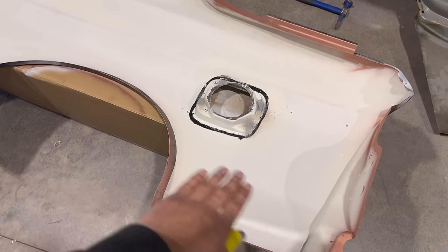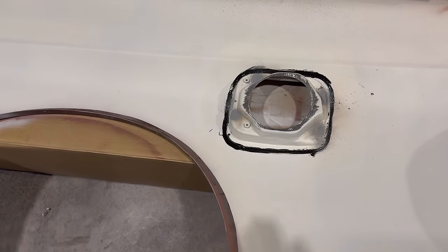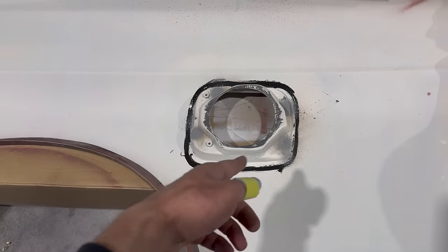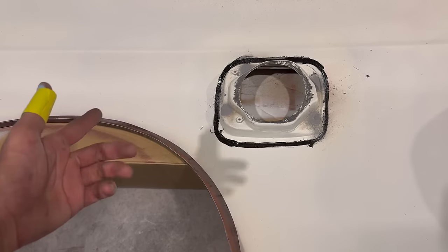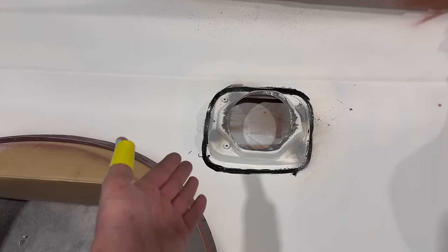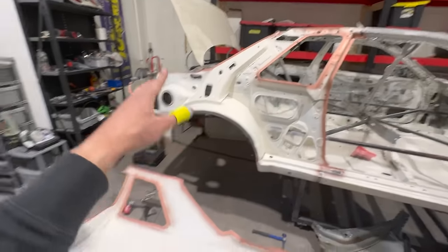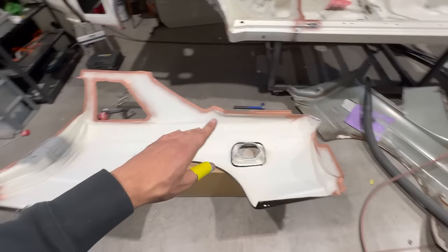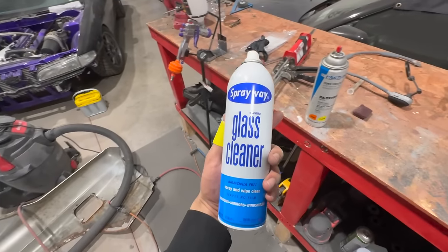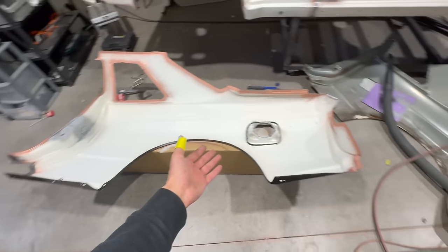Next step complete, guys. As you can see, we got this thing all in place. They had those four tack welds — now they're just covered up in primer. And we went ahead and got a nice seal around the edges with the panel bond. That's in there for good, man — fitting up absolutely beautifully. Moving on, I just went ahead and cleaned the entire surface of the car and the quarter panel with some glass cleaner. Yes, you can use glass cleaner right before paint — use it as a prep-all, like a wax and grease remover. It works out awesome. Don't be afraid to paint right over it. Make sure you've got it all nice and clean.